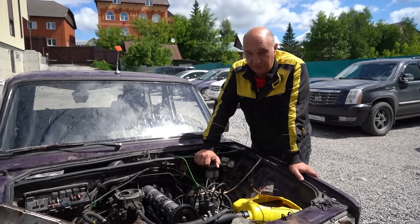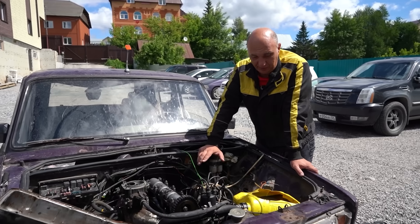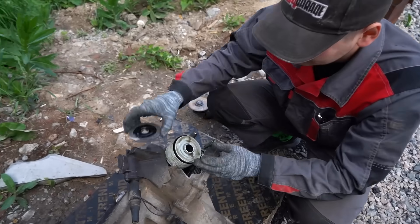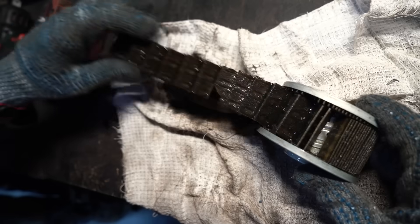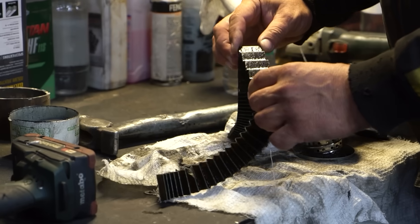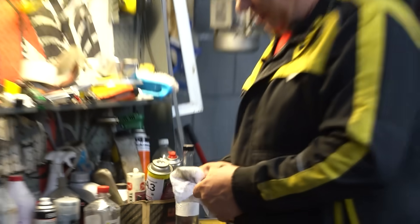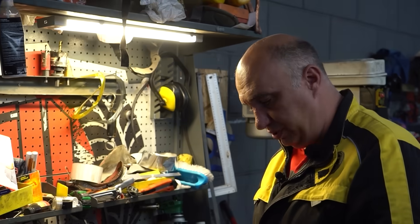Let's have a look at that oil. The oil is super dirty — obviously that's where all of the residue wound up; it was flushed into the oil pan. All it took was half an hour to get so black. So this stuff works apparently. Here's something I really think we should try — remove the filter, cut it open and have a look inside. The one we had installed was brand new, and you can plainly see what happened to the fresh motor oil. We've opened up the filter and sliced the paper, and it is ruined — it got so dirty after half an hour. It looks like the filter is totally clogged. You can see that it ate up all of the crap from inside the motor — that's a lot of sludge, and we only let the engine run for half an hour.